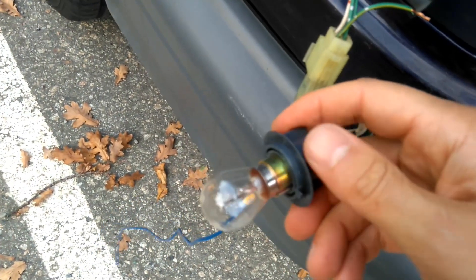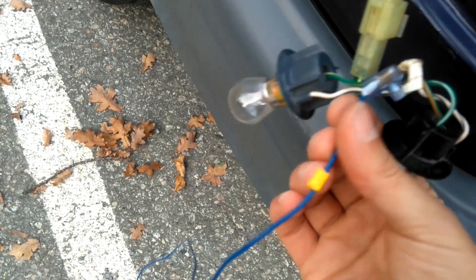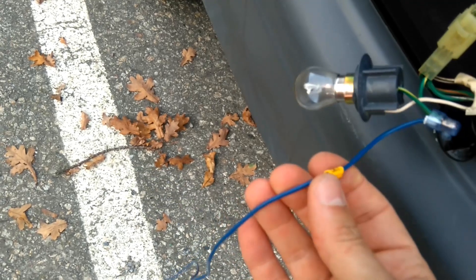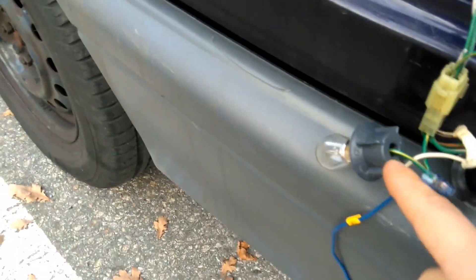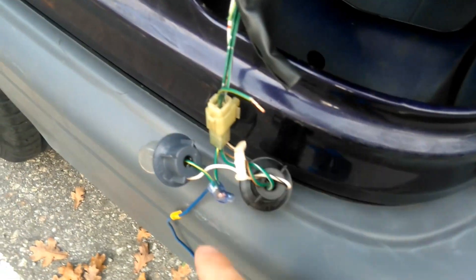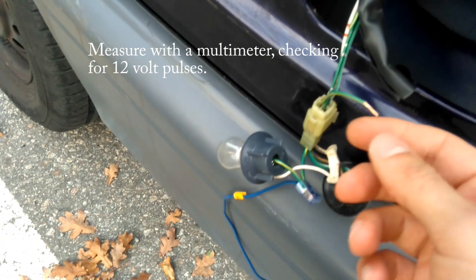The turning indicator - I've just put what we call in Swedish 'U-båt' connectors, so I connect all the wires. This one I marked up 061, and this one I will connect to the black and white here. I'll have to change the connector, but you get the picture. I measured the indicator turned on against ground so I could see that it was blinking - this is the blinker light.